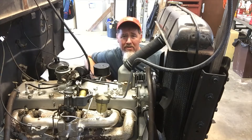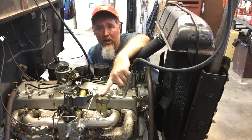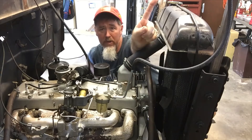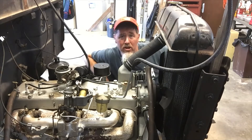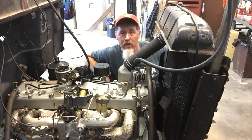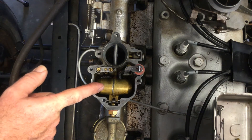When adjusting carburetors and messing with the fuel system on an old vehicle like this, they have mechanical pumps which only work when the engine is running. I really don't want the engine running with my carburetor apart, so what I do is I have a lawnmower engine fuel tank set up as a gravity-fed fuel supply.